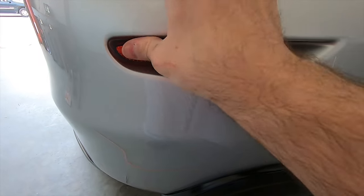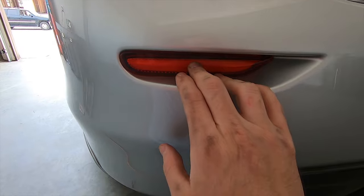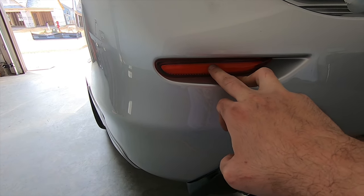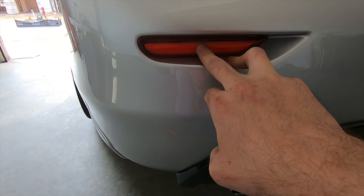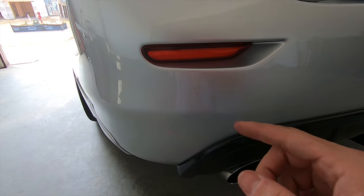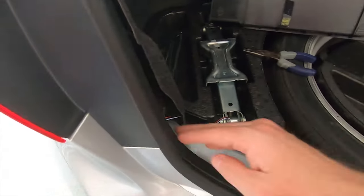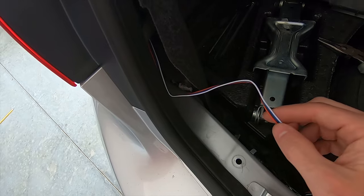In order to get the wiring behind the bumper, I basically ran it through this open port right here where the first clip hooks. I've already sanded this side down as well. Now I'll go ahead and clip that in place — inside clip first, then outside clip second — and run the screw through the inside center. One thing to note: when you go to put the screws into these new sequentials, the hole needs to be threaded first. Thread the screw all the way in before installing it so the screw goes in a lot easier — you have very limited space back there.